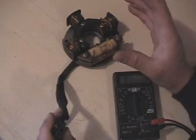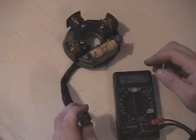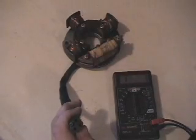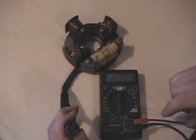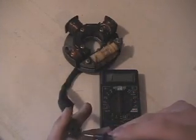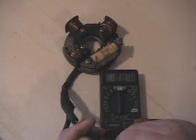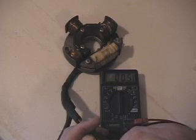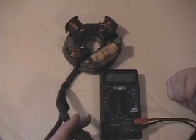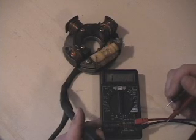To measure ohms, we'll start with the lighting coil side. You're just looking for continuity that's not going to read 300 or 400 ohms. On your multimeter, pick the lowest setting — I've got mine on 200. Some digital ones don't have settings, you just put it on ohms. Find your two yellow wires and check between them; positive to negative doesn't matter, we're just looking for continuity. It'll give you a low number like 0.5, which lets you know the wires aren't broken. If there's a lot of resistance — like 50 ohms — then you know something has shorted or grounded out and is barely making a connection.